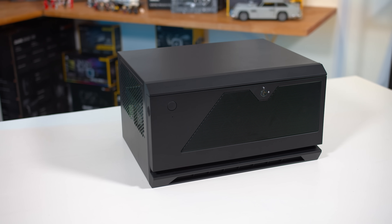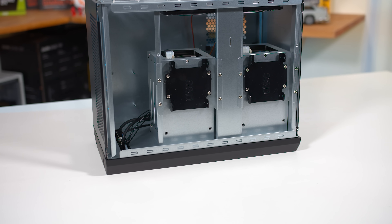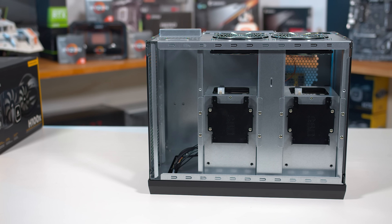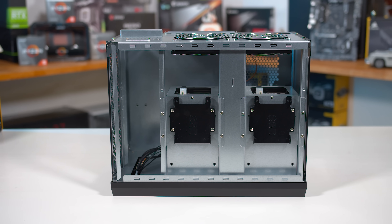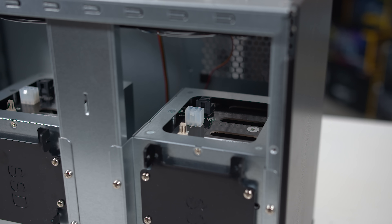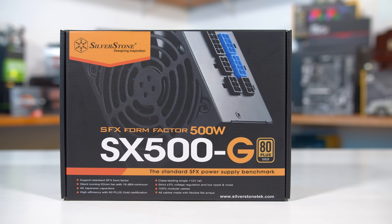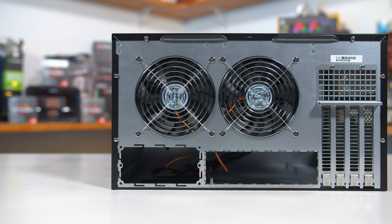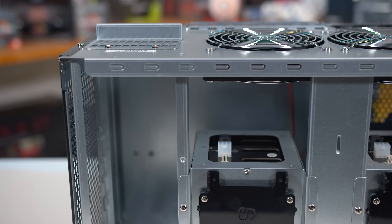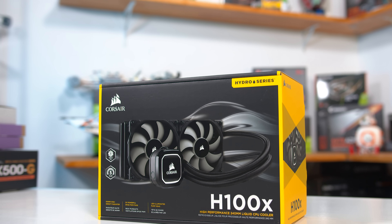The case design isn't the most attractive but that's not the point. It has eight front-access bays, space for two additional 2.5-inch drives inside, micro ATX board support, full-length GPU support, and plenty of ventilation options. Inside the case we'll need two of Silverstone's adapter cables going from the mini SAS connectors on the hard drive backplane to SATA ports on the motherboard. We'll also need an SFX power supply — Silverstone's SX500G, an 80 Plus Gold rated model. The drive bays sit over part of the motherboard so we're height-limited on CPU cooling, requiring Corsair's H100X liquid cooler.